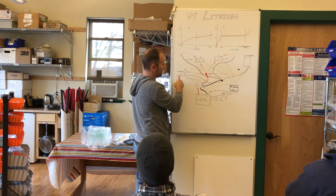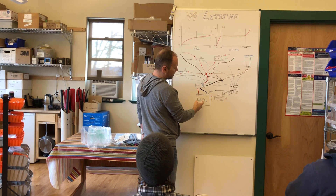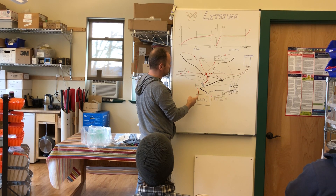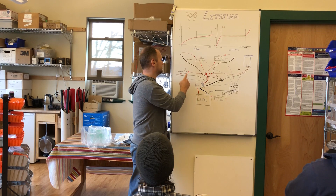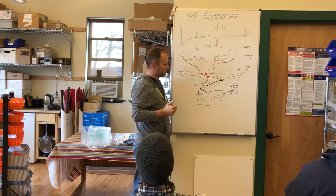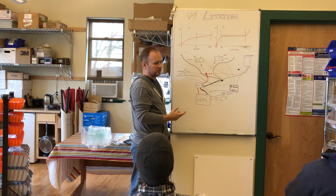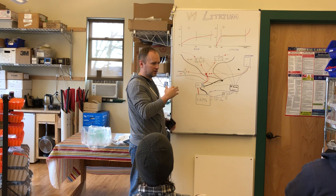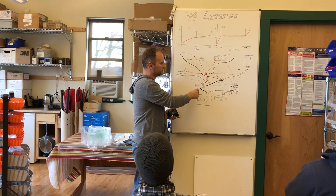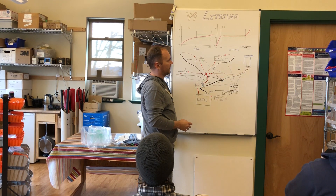The alternator is similar to solar — it disconnects if the battery voltage is too high, if there's a charge disconnect signal, or if the battery is freezing. We added a couple of extra features: it only connects when the ignition is on, because we don't want to draw power closing the relay if the alternator isn't in use. There's also a 20-second delay to allow everything in the rig to initialize before it starts charging the system.